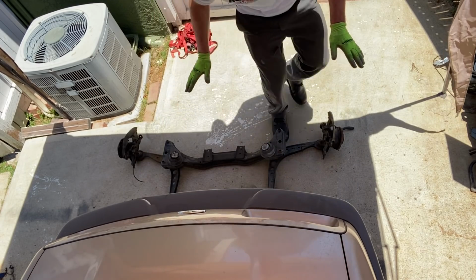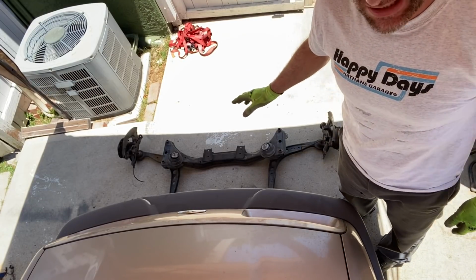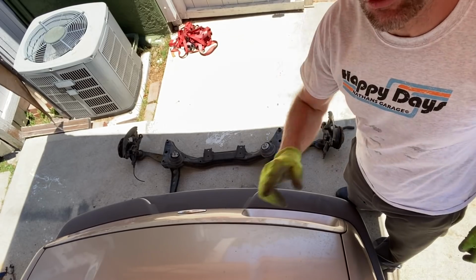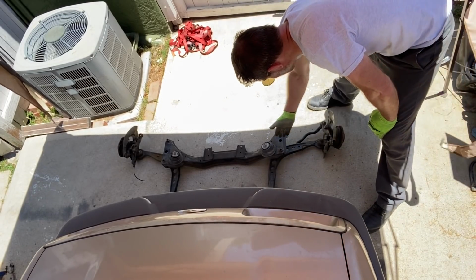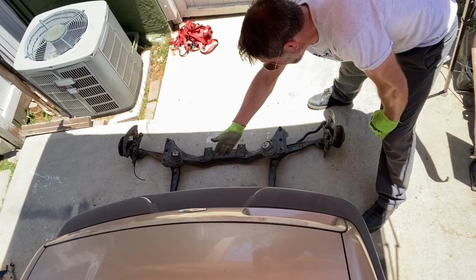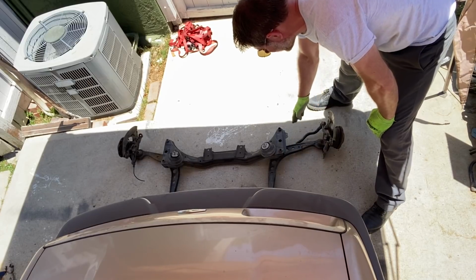Now, I want to do this without changing the car at all, so this cross member's going to get changed. Why would you do this, you silly man, you may be asking yourself? Well, the reason is, I'll wait for the plane. The reason is, on the Sierra, the front arm is just this. There's none of that. That part is taken care of by a sway bar that runs behind, then angles and goes diagonally through this bar to locate it front to back.